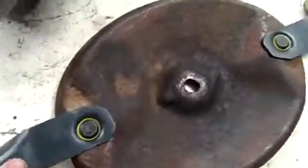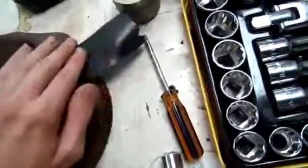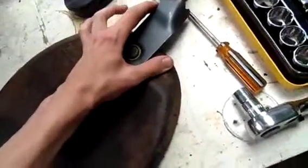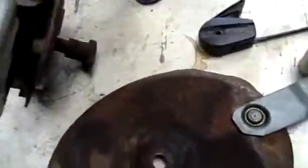The blade is all back together and ready to go on. I've made sure I've done the nuts up tightly, otherwise they'll just swing back when it hits any grass. The important thing is to do those up because they're designed to bend back under a certain amount of pressure so you don't actually bend the crankshaft.